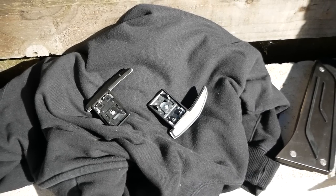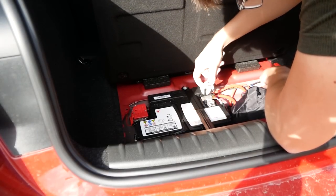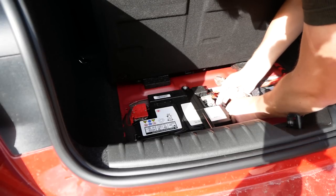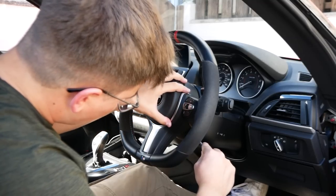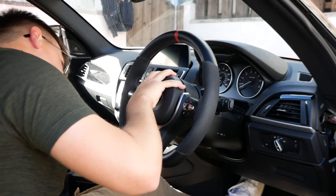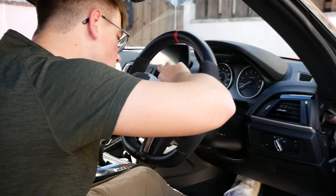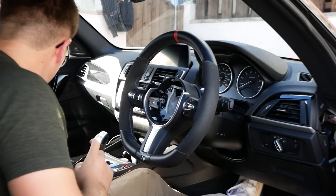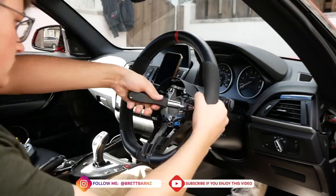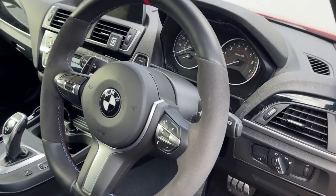Moving on to the shifters — I've decided to go with the BMW OEM ones. These are genuine paddle shifters out of a friend's M4. To install them, you'll want to undo the battery first because we're going to be unplugging the airbag and you don't want that exploding in your face. Once you've unplugged the battery, find the two holes each side of the steering wheel and push a flathead screwdriver up through it — you should hear a ping and it should pop off the airbag. Go ahead and unplug the airbag, and then you should be able to see the screws in order to take off the paddles. The OBD port still isn't fixed but it is booked in for next week, and just like that the car is now all done.